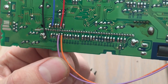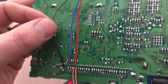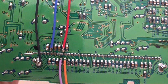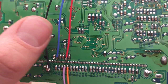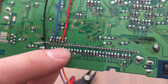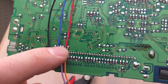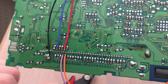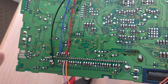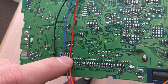We have orange pin three — right radio. Purple is left radio, pin five. Black is just tied to ground. Blue on the resistor is our left aux. And red is our aux right. That will bypass it because of that cut. Signal goes through orange into the switch, and if nothing's plugged in, it follows through into the red and continues on. Purple does the same thing. But if an aux is plugged in, that will not connect those two, and will take the signal from your phone or whatever you're playing and pass that in right and left into the system as if it were the radio.